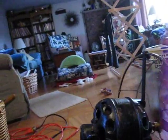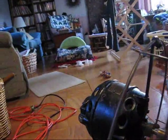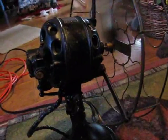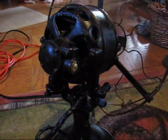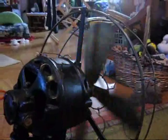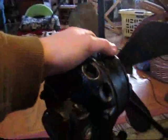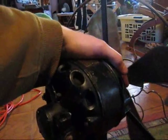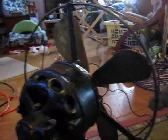5 speeds are interesting and quite rare on a fan made after the single digits. I think fans with 5 speeds were phased out pretty much when the pancake motors went out. The bearings are still out of alignment a little bit — I need to figure out how to realign them. And when I'm realigning the bearings, I want to find out how to open up the motor housing, because I think if I keep the shaft from being pushed back into the motor housing, it'll stop making this awful noise.